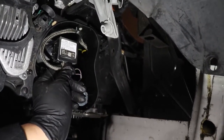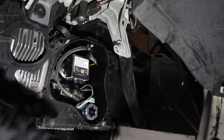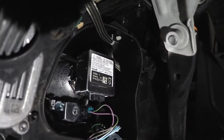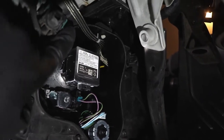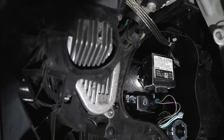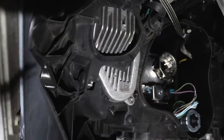So we're going to go ahead and take that out. There's just a little plug on the bottom — unplugs. And then all we got to do is come in here and release this. So I took a minute and looked around online. This is actually a different style than all the ones that I've seen for the 335i. All the ones I could find have the little clips that go over the back of them. This is actually a new different style and it's actually really easy — all you do is twist it like 45 degrees or so, and then the light comes right out.